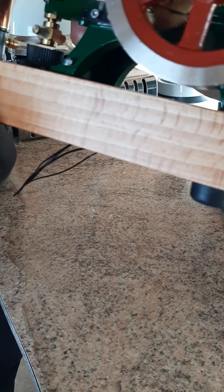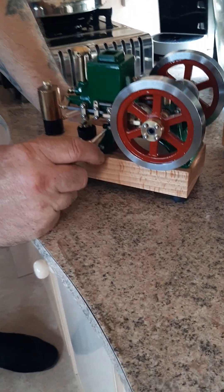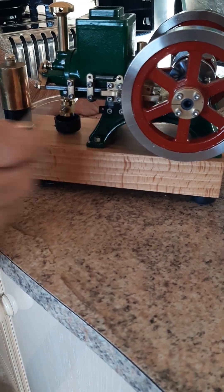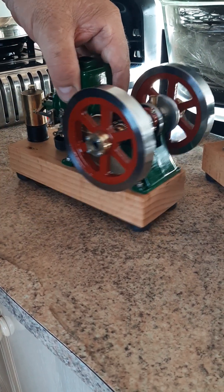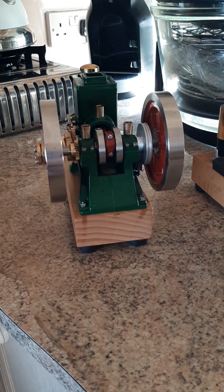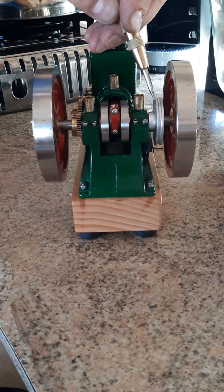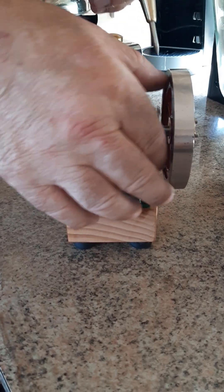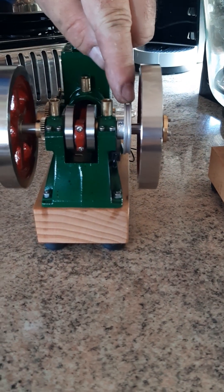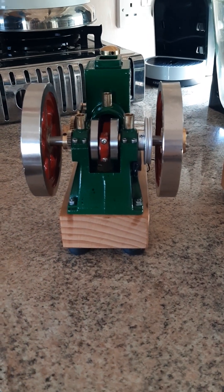You just couldn't make that up — it's perfect for the job. The wires go in there and out the side, and if I look at this engine underneath, you can barely see any wires whatsoever. On the previous system with the contacts on the side, you had some horrible black, white, and red wires which went down there and they did look unsightly. This system eliminates all the adjustments that need continually doing and cleaning, and the timing is so easy to adjust — just slacken that little screw and rotate the disc left or right before top dead centre, bang on dead centre, or just after top dead centre to get the engine running as you want it.